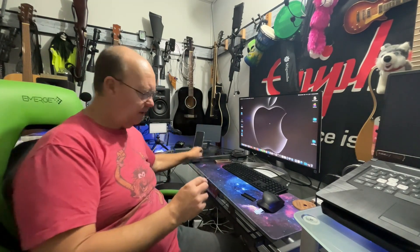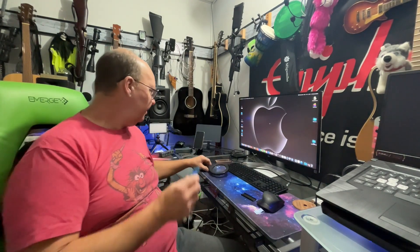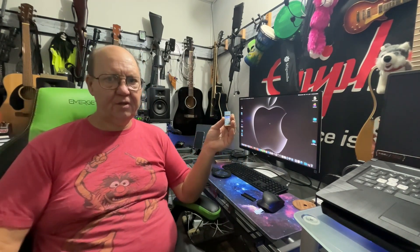Right on boot up the drive is already running hotter. I have two WD SN570 drives that are exactly the same. One is sitting in an external Sabrent case where I've been experimenting with cooling — I had to add an extra pad on top of the built-in one because that pad didn't even touch the drive. I've noticed that without anything touching the top of these drives, they run cooler even in external cases. With silicone on there, it actually runs hotter — whether it's a boot drive or a data drive.